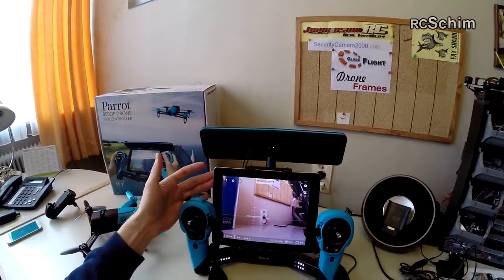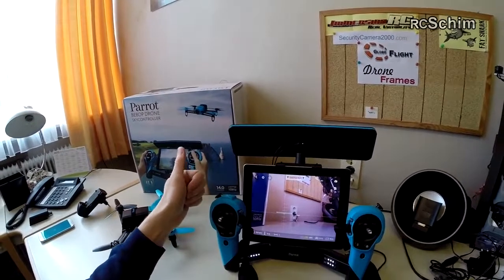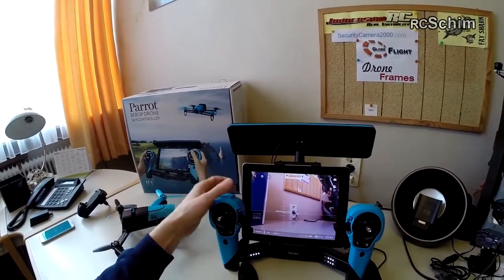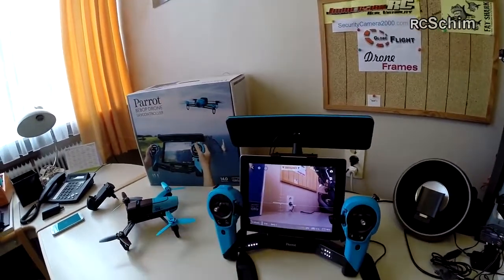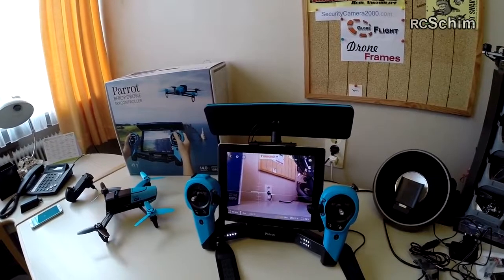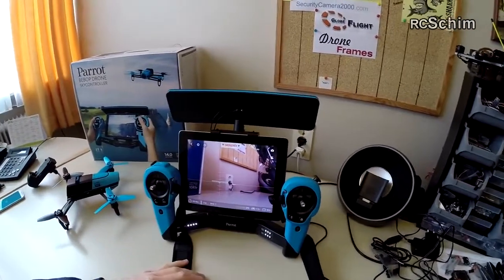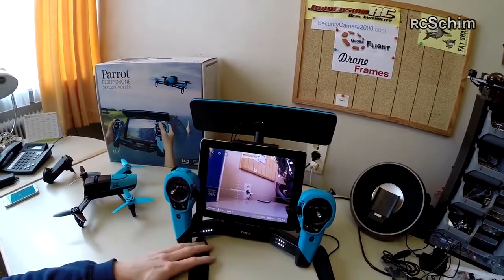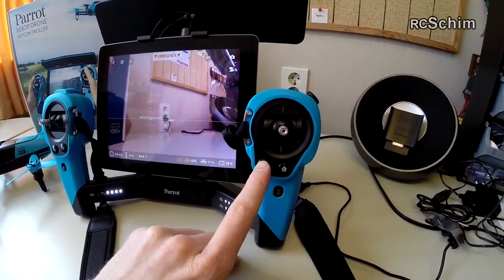They tell you that in environments with no interfering WiFis, and using the Sky Controller in highest power mode if legal, you can reach 2 kilometers — which would be really remarkable. If you just use the iPad WiFi you can expect around 300 meters under optimal conditions — that means no humid air, optimal iPad orientation, no other WiFi signals, and the best WiFi settings set up in the app. If you have it set to auto that's not an optimal setting, so make sure you set the right one. I'll link you an article from Parrot where you can read about the best WiFi settings.